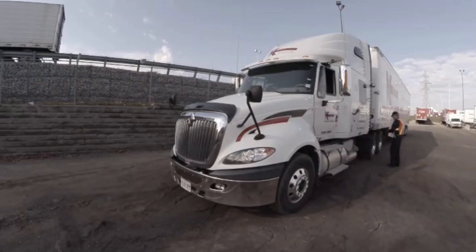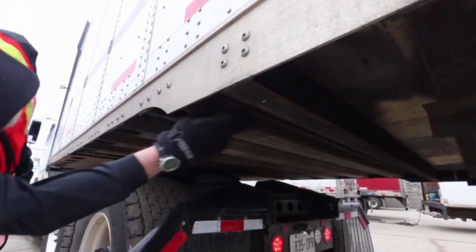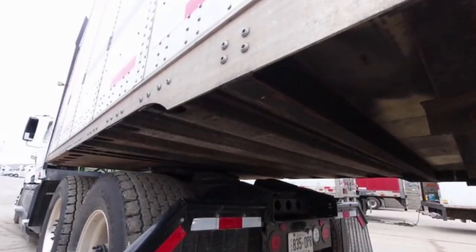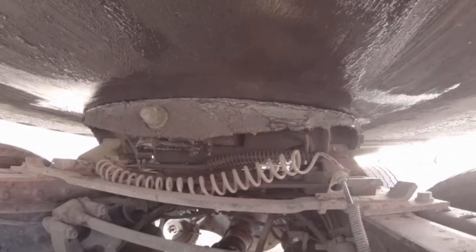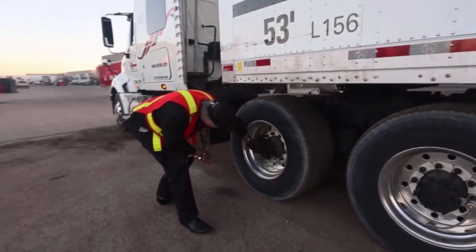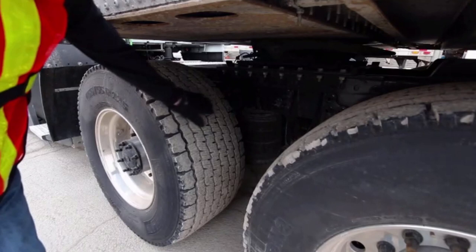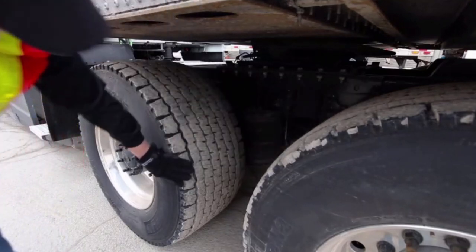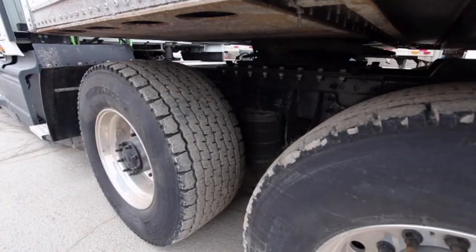Continuing, check top to bottom — we're looking for any damage, breaks in the skin on the side of the van. On the lower end, we're looking for damage that would have taken the heads off any cross member supports. I'm checking here for the fifth wheel pin to make sure it's in. I'm looking at my own tires, making sure there's no cuts or bulges. The tread is sufficient. With drive tires and trailer tires, you need a minimum 2/32nds of an inch tread depth, and you must have more than two treads grooved. If you're flat spotted in any way, that's an out of service criteria.